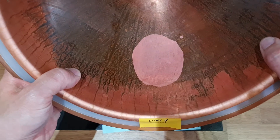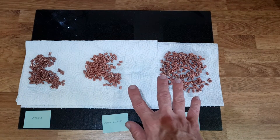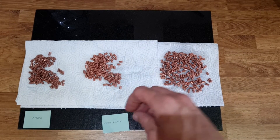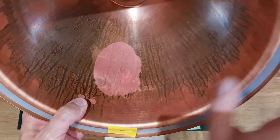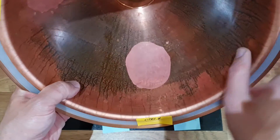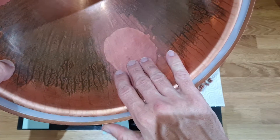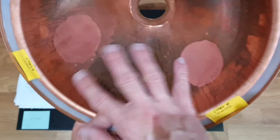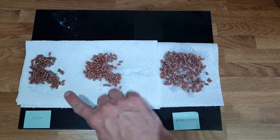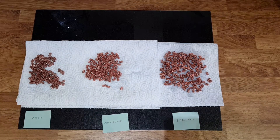The citric acid and peroxide did an even better job on the head, but there's a bit of an issue. When I ran these I ran them all at the same time, so they all had exactly the same time to clean. But for the head, this one had about an hour and 20 minutes sitting with oxygen, and another had 40 minutes, and the last only about 10 minutes. So naturally the one with more oxygen exposure is going to look cleaner — this isn't really a fair test for the head comparison.